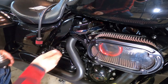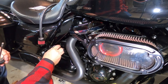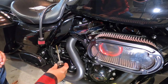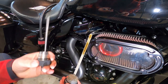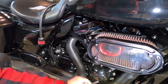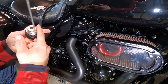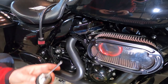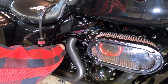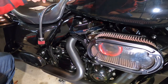Put this up here. What they recommend is you take off the oil cap just like so. There's nice synthetic oil in there, nice and thick. They want you to take a little bit of the oil and put it onto the O-ring gasket that goes around here. So I'll put a little on my finger and put a little on the O-ring. Then wipe that off and screw it right in, snug it on there.